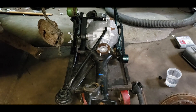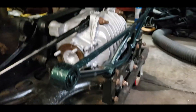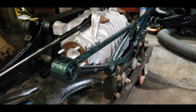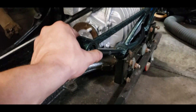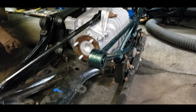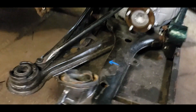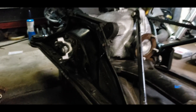Quick update: I am finished mounting the center section and all the bracketry. I ended up reusing the X308 rear brace — I tweaked it just slightly to make a little more room around the outside of it. Because it does move back and forth a little bit, I just didn't want to have to pry it in place. I got everything mounted like it's supposed to be. That was a bit of a pain because I didn't want to take the yoke off since the preload is already set and the crush collar is already smushed down.